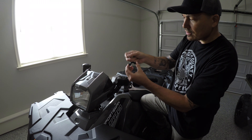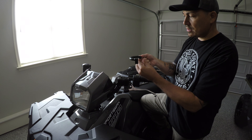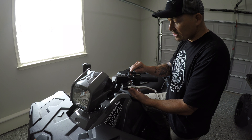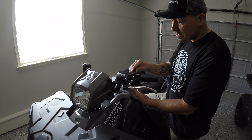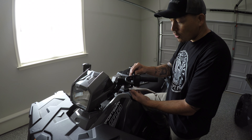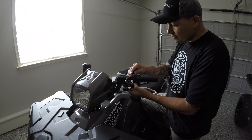The stock clamp comes right off and you replace it with the mounting bracket. The way you're going to determine which handguard you're going to use on which side is: the handguard mount is going to have a curve that curves around the brake master cylinder mount.